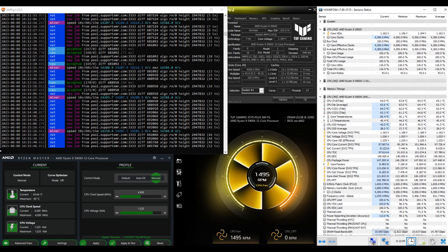For all of these tests, I'm using the same CPU frequency of 4300 megahertz, V-core at 1.225 volts, and the CPU cooler fan at 100%. There are slight fluctuations in fan RPM, but those are just momentary — up or down about 5 to 10 RPM within the 10-minute snapshots. I mine Monero, which is a CPU-intensive algorithm, even more intensive than running Prime95 with small FFT by about 20 more watts. I do that for a couple of hours, then reset the values in HWinfo and take a 10-minute snapshot, manually watching and recording the ambient temperature during that window.